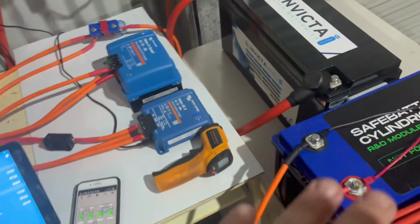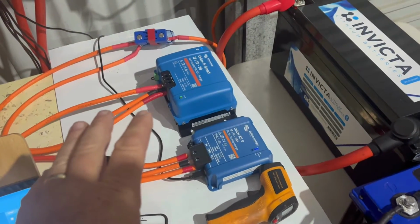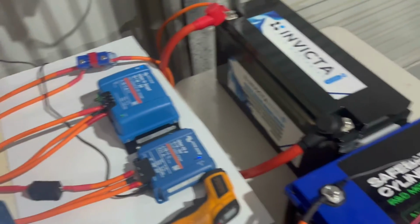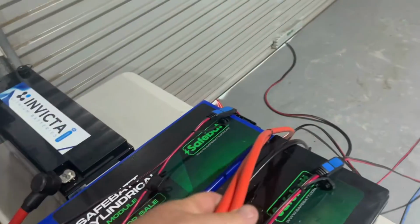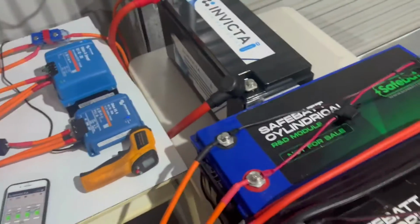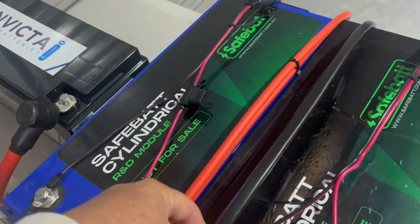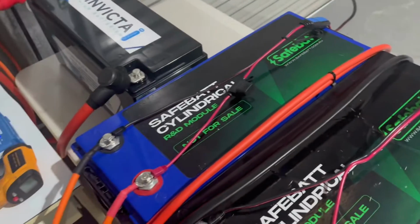So what I'll do now is I'll let these run for a little while. We'll let them heat up, and we'll see what sort of temperatures we get out of these. Then I'll plug the ute in, which I've already run the cable for, and the ute's just sitting outside there, and then we'll see what we get out of that. And I've also got this smaller, I think it's 8 mil squared cable, and we'll see whether having less diameter cable has a massive effect on the charging.